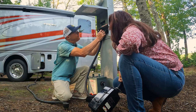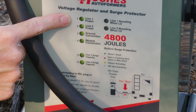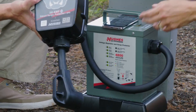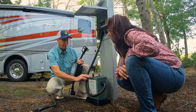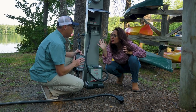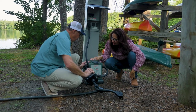Let's check this out — put it in here, plug it in. Everything is green: Line 1, Line 2, grounding, neutral — any polarity issues, any grounding issues, this tells us. The important part about this is it has the emergency power-off system, which means even if this doesn't boost, it's gonna shut off all the power to your RV so you don't surge and fry your air conditioner. So we plug it in on this side.